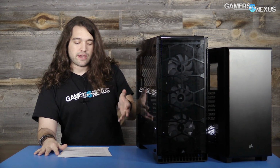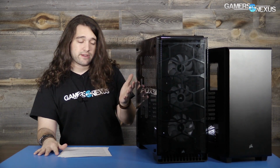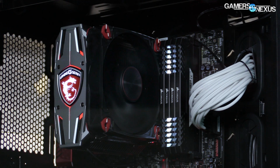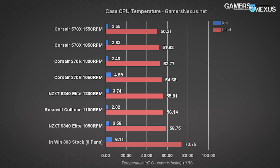And then when all that data is collected, we create a delta value, so you get your delta T over ambient, and that's what tells us, because ambient can fluctuate from second to second, it gives us a good look at case performance when accounting for ambient. One other thing to note, our methodology is accurate to a point of plus or minus 0.5 Celsius, and again, complete testing methodology in the description below. Let's start with the CPU temperatures.